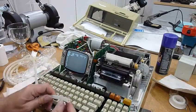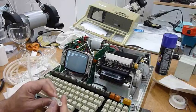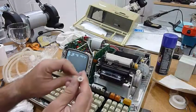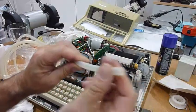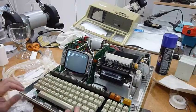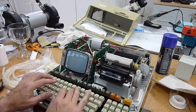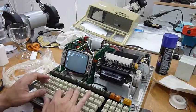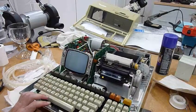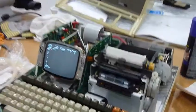I finally figured it was the wheel that was too hard. So I went back to my surgical tubing and put a piece of that over the capstan. Now things are much quieter, and you can do a rewind. This is much better behaved.